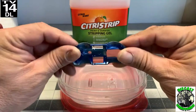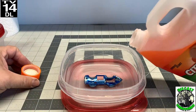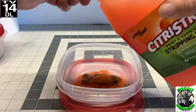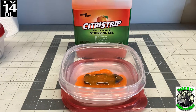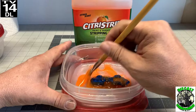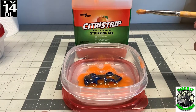Here we got the body in a nice container, and I've drilled the post out so that's ready to go. We're going to use some Citrus Strip from Walmart to strip the paint off the car. Now there are a lot of better products out there like aircraft stripper, but the Citrus Strip is very reasonably priced — approximately $11 a bottle at Walmart. It takes about half an hour for this stuff to work but it's a lot more user-friendly. Aircraft stripper runs anywhere from $25 to $45 for a can — incredibly expensive, but you get what you pay for. Let's let that sit for a while.